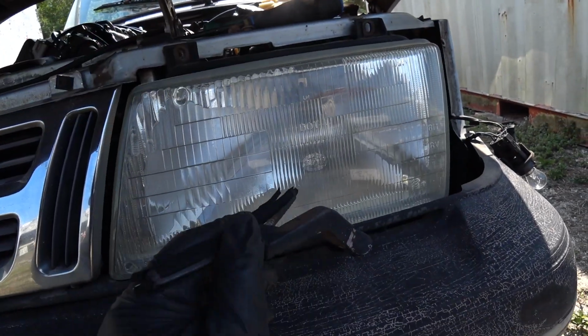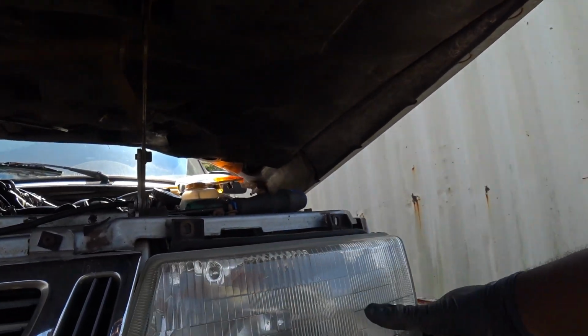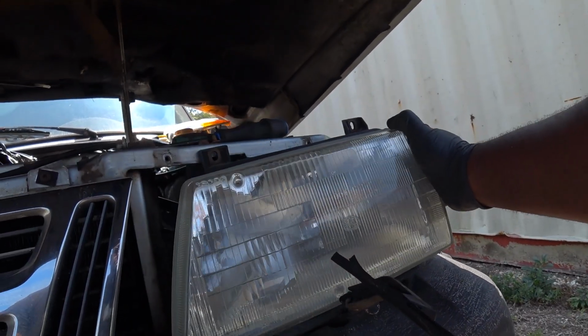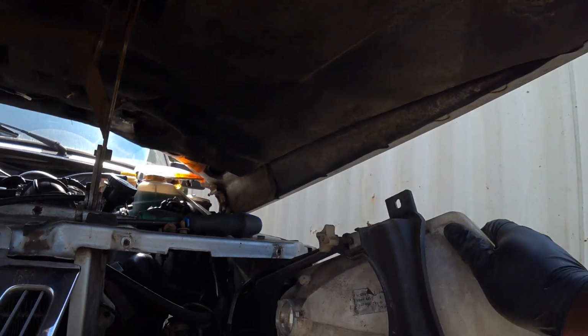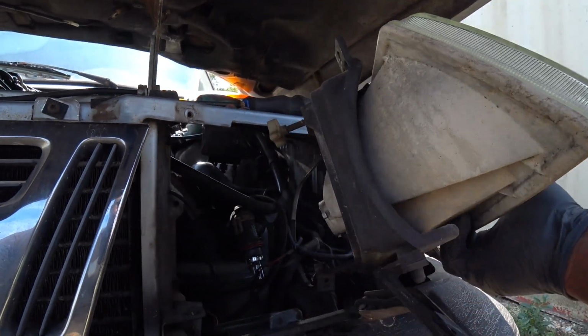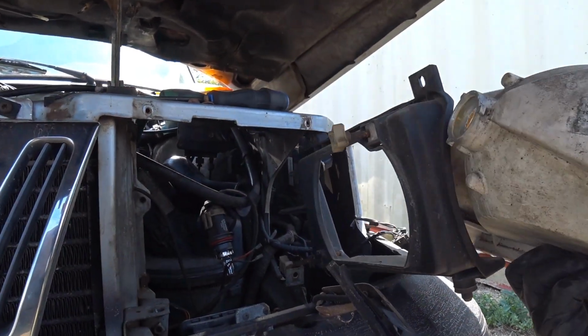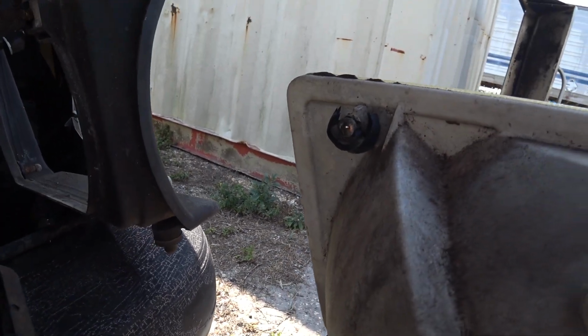If your Saab has headlight wipers, simply move the wiper arm to one side and allow the assembly to pass by. You will see that when I remove the carrier that the adjuster just snapped with minimal force, and that's the purpose of this repair. That didn't take a lot of force. In fact, the right lens, which has been replaced, broke while I was driving.